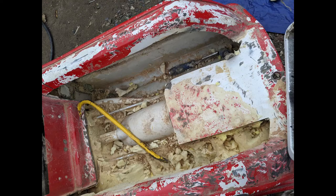My brother noticed it. Everybody noticed it. And I'm a veteran rider, so I know how to shift my weight forward and everything like that. But the ski was definitely unrideable. I put it on the trailer, brought it home, and I noticed there was water dripping from the back of the ski. And at that point, I knew my ski was weighed down so much that it was causing my ski to porpoise. I decided to defoam my jet ski.